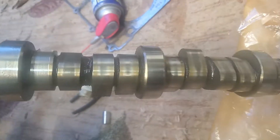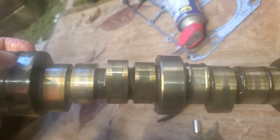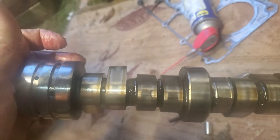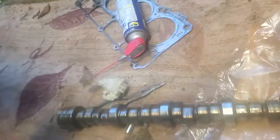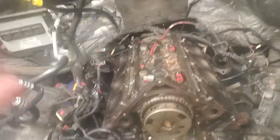No wonder the truck had a miss. The next lobe is showing some weird wear too. This is at a hundred and thirty-nine thousand miles — I'm going to say just under 140k — bad things start to happen. So if you've got a 2011 Ram, it's notoriously bad from what I understand.